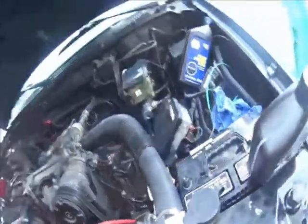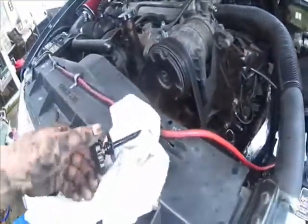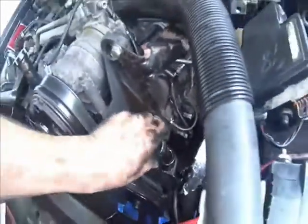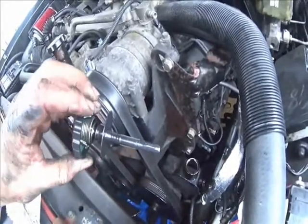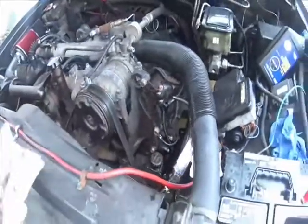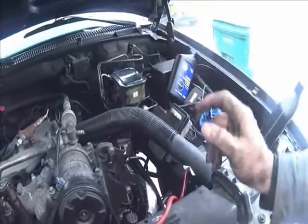Let's see what she looks like — dry as a bone. Yep, dry as a bone. Good, good, good. Now I'm going to check the fluid one more time at the power steering pump right here. It's right at the line, but it looks a little on the milky side — I may change that in the future. But yeah, that's the high pressure line for the hydro pump braking system on the Chevys.